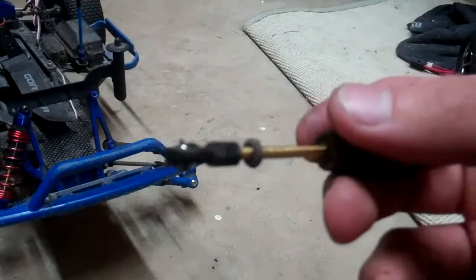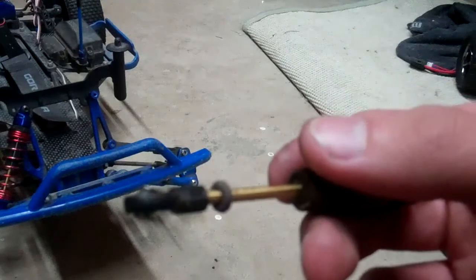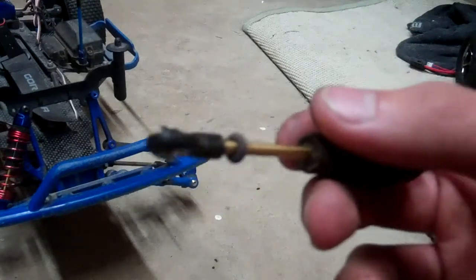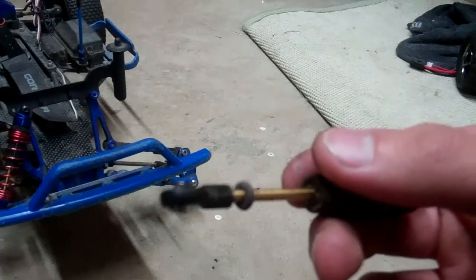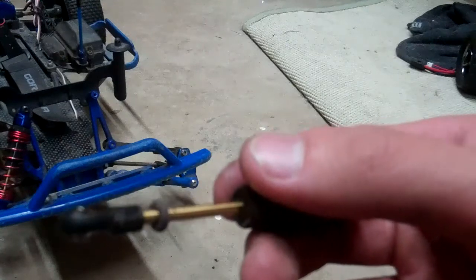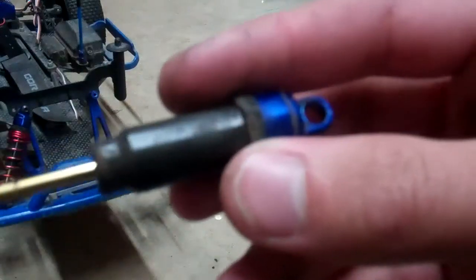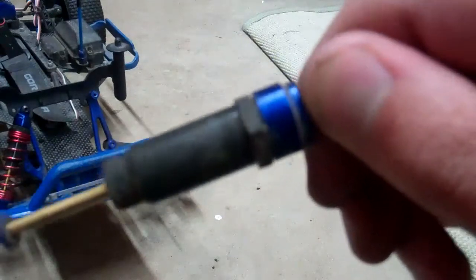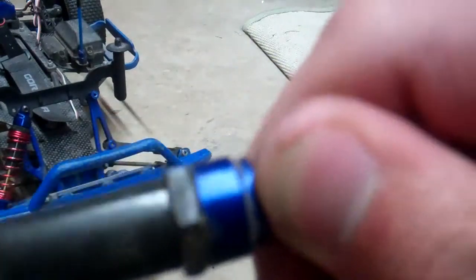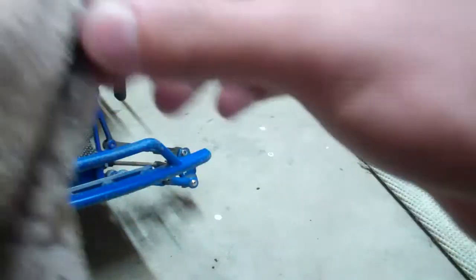Depending on how dirty the conditions are that you run your kit in, and also other factors like how often you clean it, you generally want to clean your shocks every couple to few months. Also, the shock casing or shock chamber that the oil goes into will probably need to be wiped off. So just take a clean rag and wipe it off.